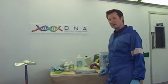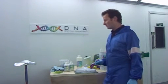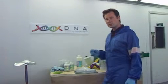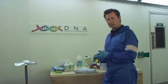When mixing your contrasting colour, which is also a base coat, to go over the mutant crystals, I want to mix it a little bit thinner than normal. I recommend a 60-40% mix. It'll spray a little bit thinner and won't build up too much film build over those crystals. If it's too thick, it'll be harder to wash off.